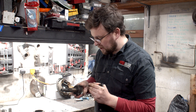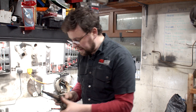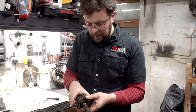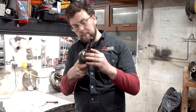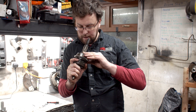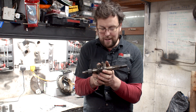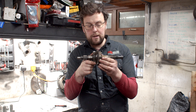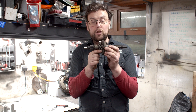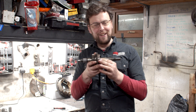This is one of those early gearboxes and these balk rings are absolutely phenomenal — if you can get these old early balk rings and those early gears, they hold so well. There, I'm not able to turn them by hand, but in the case where you've got an engine and gearbox they'll turn no problem. So what happens is: the synchro inner goes in, drives that balk ring up, the gears match speed, and then the dog teeth can come together, and what that gives us is what feels like a completely seamless gear change.